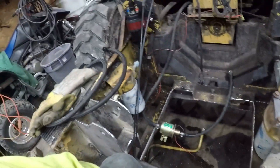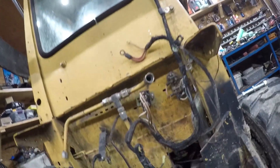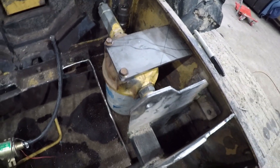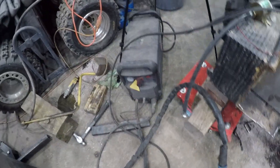Got some brackets here made — this old one I was able to cut down and modify and it'll work. I'll trim it up — it'll be show worthy. This one I got to cut; it looks like it might not work, but we'll take that check valve out there. Bolt it up and then run my flexible line and make sure it fits the bell housing and what not. With all this, I will have to take a plasma cutter and cut out the bottom here to make sure everything fits. If I ever do want to change it, I'm going to cut out the bottom side of this here using the plasma cutter — it gives you exact, precise cuts. Make sure you use proper eye protection.